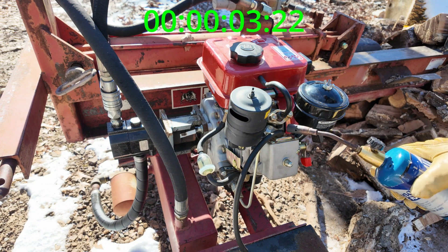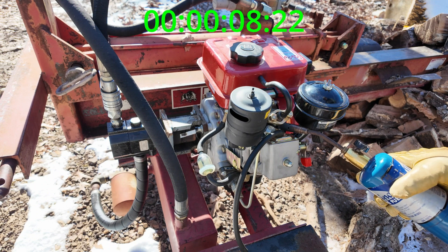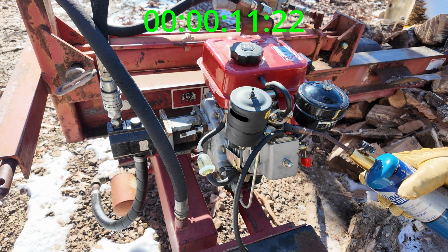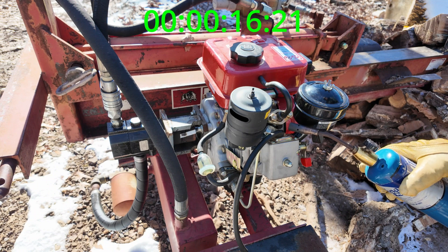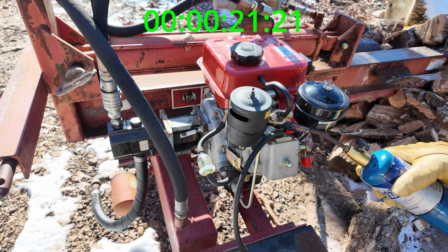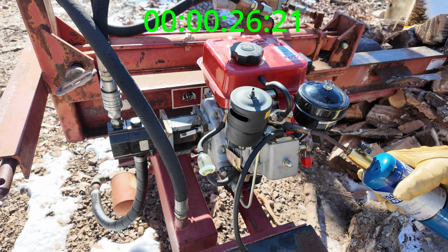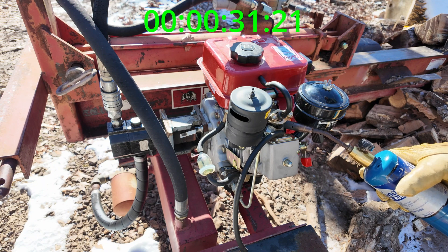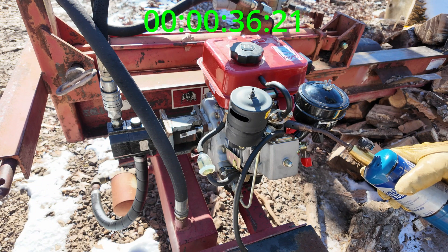Okay, I've started my timer. All I'm going to do is kind of heat around that fuel injector area — try not to leave it in the exact same spot at any given time. I don't want to burn anything up. There's no rubber right down in that area. Aluminum is usually pretty good at dissipating heat pretty quick, even with a torch, so the odds of cracking something I think would be pretty minor.